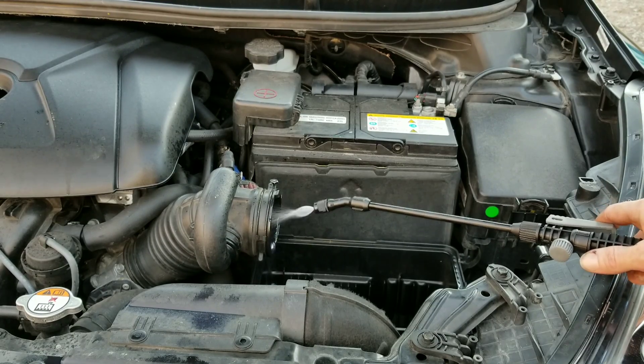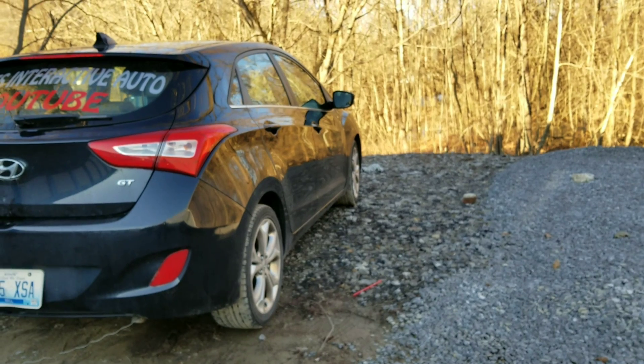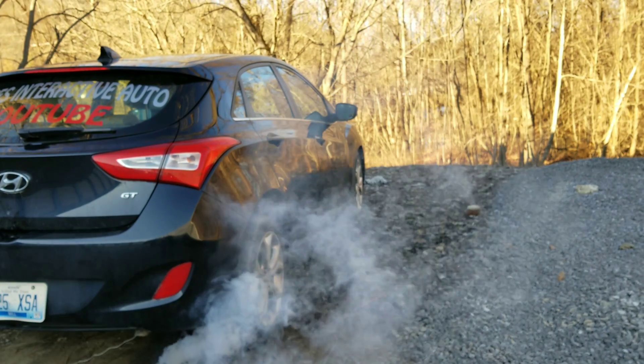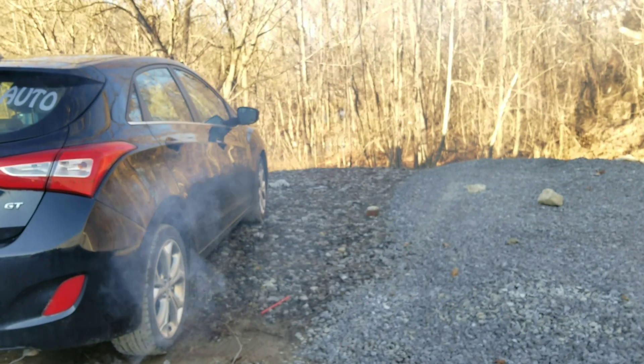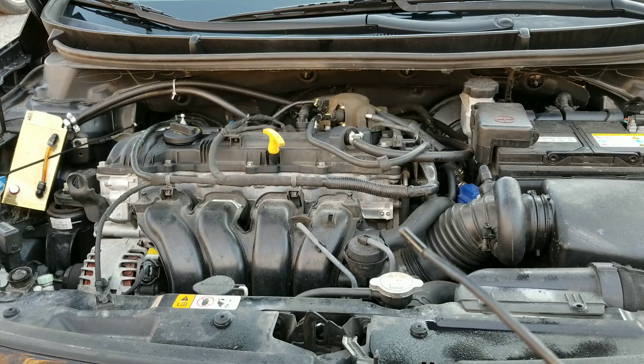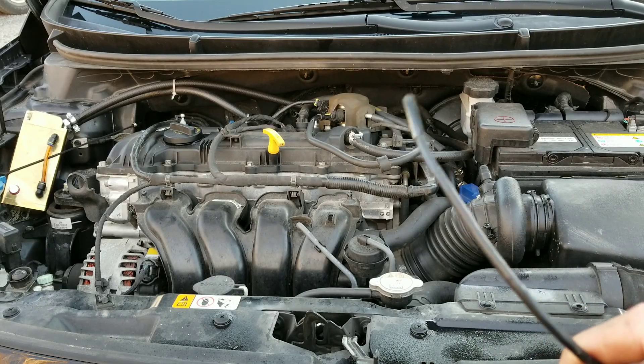All right, we're speeding it up. After allowing it to heat soak for one hour, go ahead and start your engine up. Once you finish spraying, make sure you raise the RPM up to about 3,500 RPMs two to three times, then cut your engine off after letting it idle for a moment, then start it back up. I recommend taking it on the highway for about 10 minutes, then come back and look at your results. You can also allow the heat soak for about one to two hours before your drive — that helps out a lot.